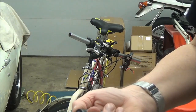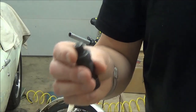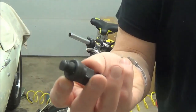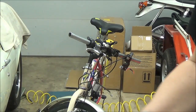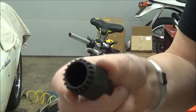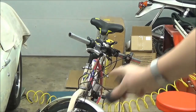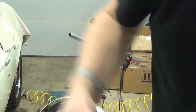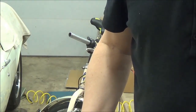They claim they rotate and counter-rotate — I'm not sure that's the case. I'm just going to have to find out. These threads you want to be very careful with so you don't cross-thread them on your crank, or you'll be an unhappy camper. You go in there — counterclockwise to unscrew the left side, clockwise to unscrew the right side — and the crank should come apart. Then I'll fiddle-faddle and see how this all sets.